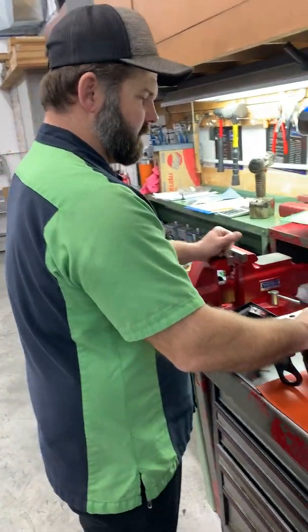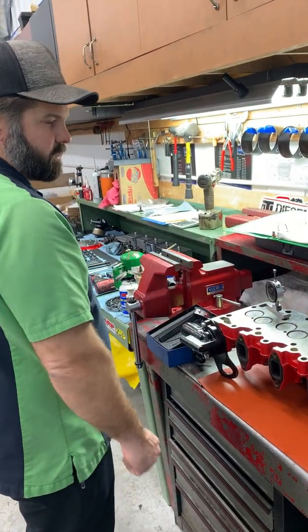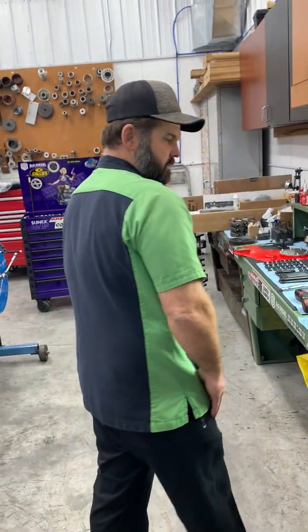If you don't have the recommendation by your cam manufacturer on valve face depth, you need to cut the seats or grind the valves and get it fixed. Make sure it's addressed.